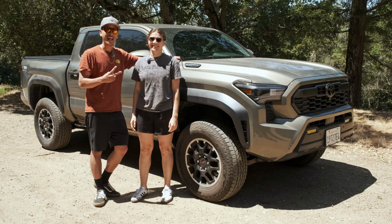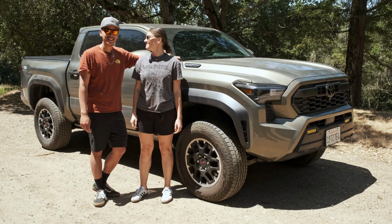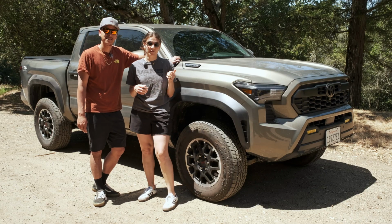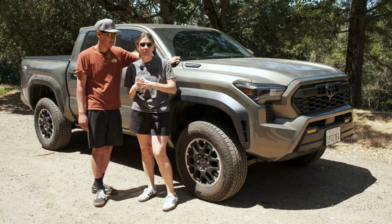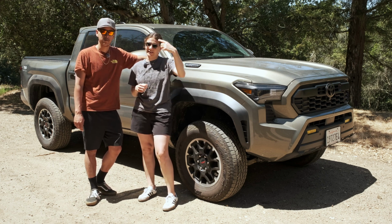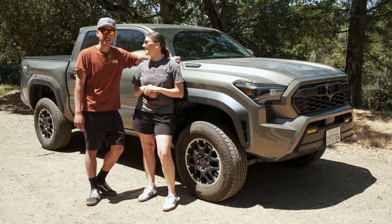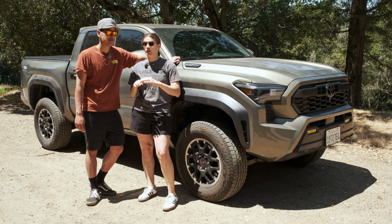It did take 2 days in 2 different locations, but yeah, it's all good now, and we really love how it's sitting. They have a 2-piece collar lift that we put in here. We went with, you could pick and choose what you want, but we chose the 2 1/4 in the front and then 1 inch in the back. Yeah, and when we first ran out of time and we only did the front, it kind of looked pretty level. Yeah, that looked like a true level.